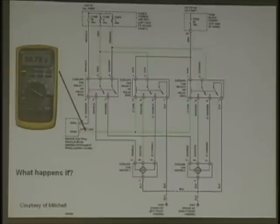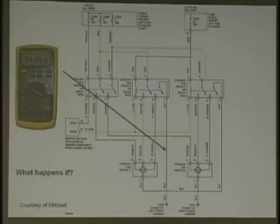That's a computer. But again, if that's supposed to be grounded, all right, the PCM is grounding it, what should that voltage be? Close to zero. So again, you could write there, if this wire is 100 millivolts or less, that's when everything is working right. That's the signal or reading that you would like on this computer circuit. Does that make sense? 100 millivolts or less. Okay, let's move on because we've got a lot more to cover.